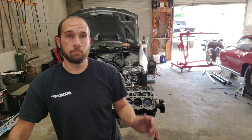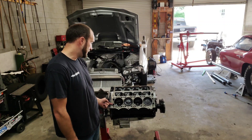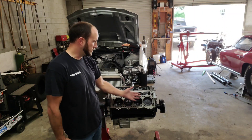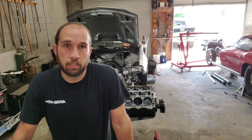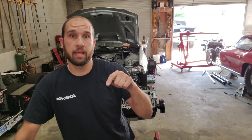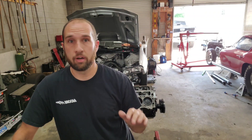What dry decking means is: blocks and cylinder heads have water passages around all the cylinders, and it passes through the head gasket into the head. So the surface of the block has water passing through it. What I'm going to do is seal up those water passages and just circulate water in the front of the head, then out the back of the head, and same way with the block — in the front and out the back — so the water from the block and the heads will never come in contact.